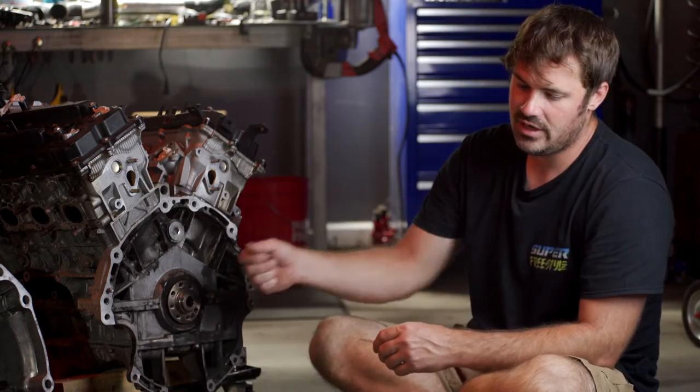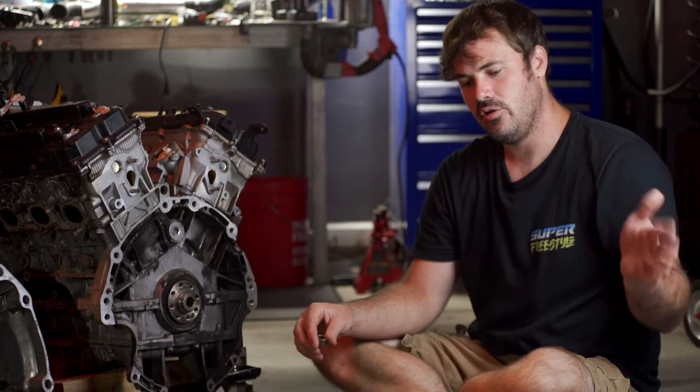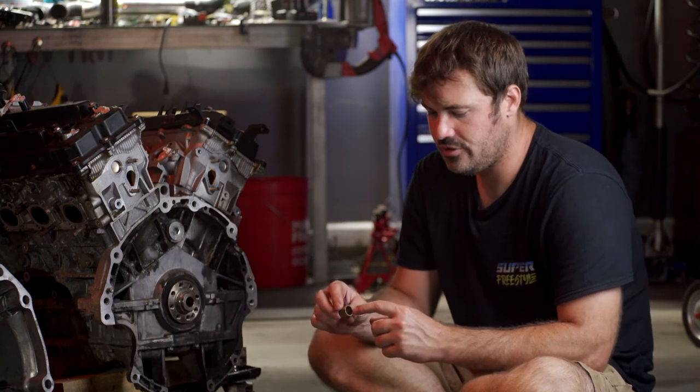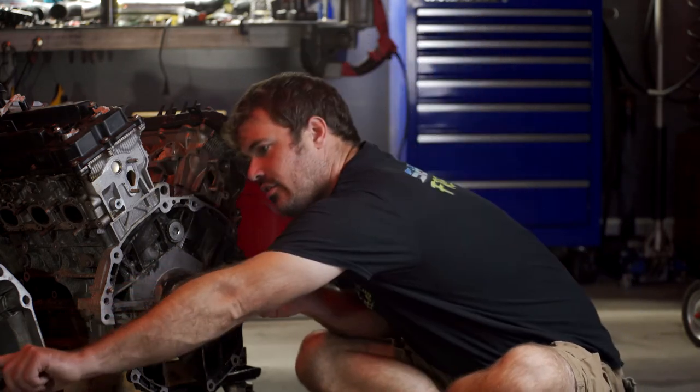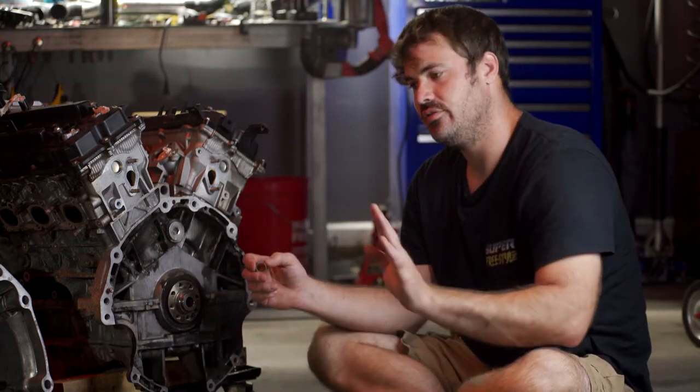If you are having issues getting your car in and out of gear even with the clutch depressed, and you've determined that you don't have any hydraulic issues with the master cylinder or slave cylinder, and you're getting full range of motion on your throwout bearing, this is very likely the cause. If this bushing is damaged or scored in any way, it can very easily grab the input shaft and bring it up to the speed of the crankshaft. It's very important when you push the clutch down for the input shaft speed to decrease so that the synchros can align the gears and you can put it into gear freely.